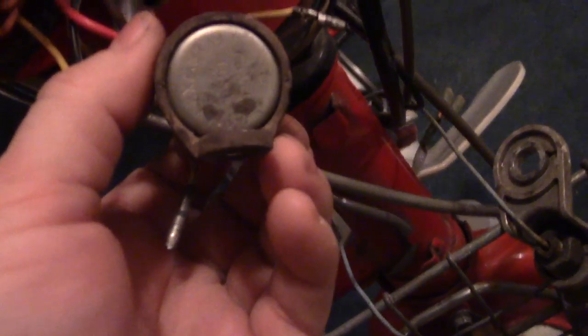This other wire ties into a green wire here, which probably comes off the turn signal switch. And check this out — this is the turn signal relay they used. This is such rinky-dink wiring. It doesn't look like a handy homeowner special or anything, it just looks rinky-dink. A lot of splices — for what reason? If it was truly factory, it wouldn't have been done that way.